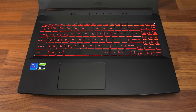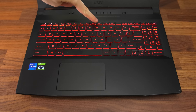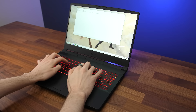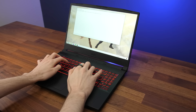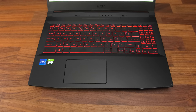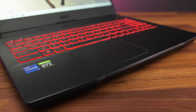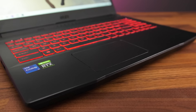My keyboard has one zone of red backlighting, but the white model would have blue lighting. All keys and secondary functions get lit up, and F8 cycles between three brightness levels or turns them off. The keys have 1.7mm of key travel. Typing isn't too bad and gets the job done, but the numpad was very squashed and the enter key being underneath zero caused problems. The precision touchpad was a little loose on the right side, and presses sometimes didn't register properly — I'd be sticking with a mouse.